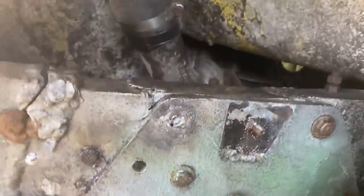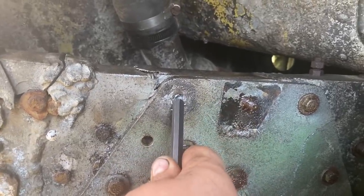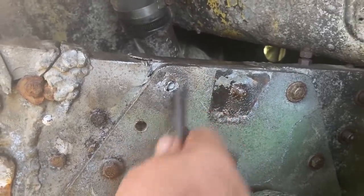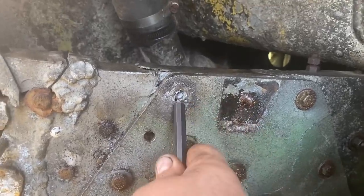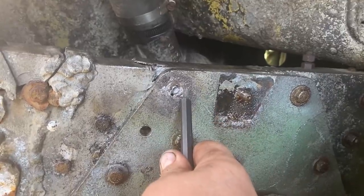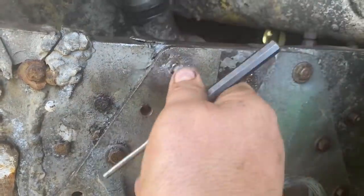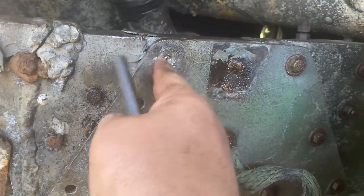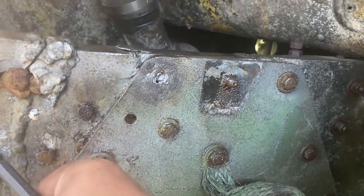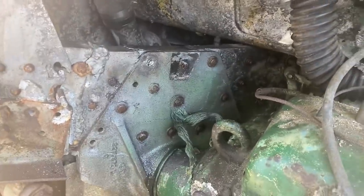Well, staying true to form, it's fighting us like crazy. This bolt, I got the nuts off the backside of it. The bolt would not turn, even with no nuts on it. Stripped out, rounded out, couldn't get it. Cut the head off of it. Can't pound it out. Heated it with the oxyacetylene torch around it. Sprayed it with Kroil. I got it moving just a little bit, but that's aluminum, dissimilar metal corrosion stuff. It just, oh my goodness. And this is number one bolt. Some of these are gonna be really hard to get to. We got a fight in front of us. Oh, there are.